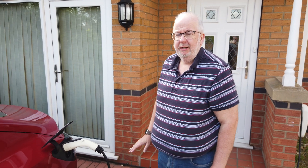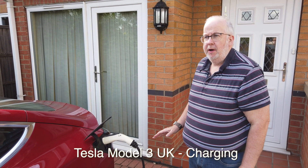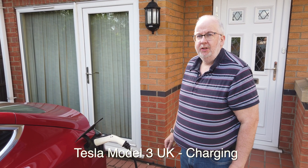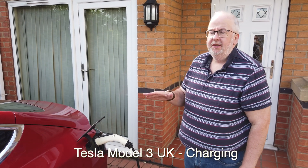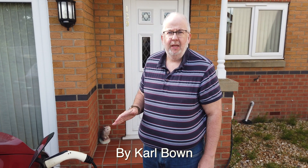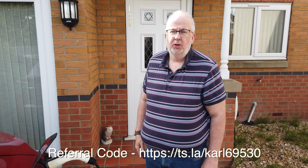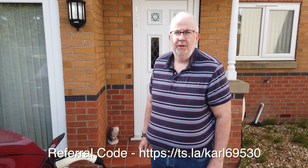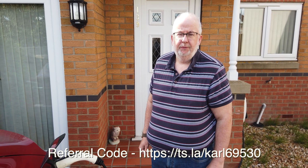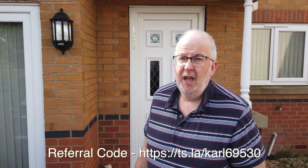Just remember to do it all the time. Tesla recommend that you leave it on charge all the time and then the software in the car will manage the battery for you intelligently, so you don't have to worry about taking it off charge. One of the settings in the car allows you to set how much you want the battery to charge to. Tesla recommend no more than 90% for day-to-day use, but if you're going on a long journey you can just head it up to 100%. I hope that's been useful and informative — any questions, just feel free to post a comment and I'll speak to you soon. If you like what you see, give us a thumbs up.